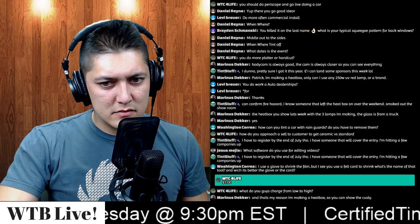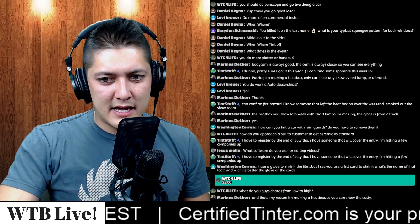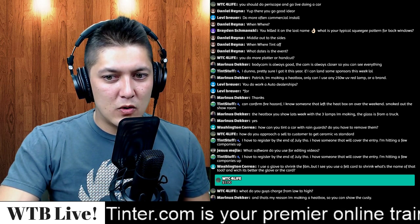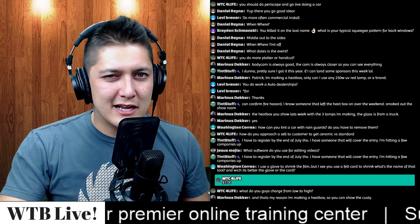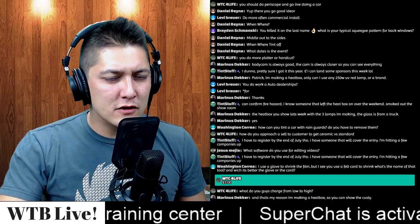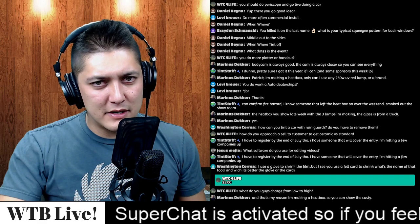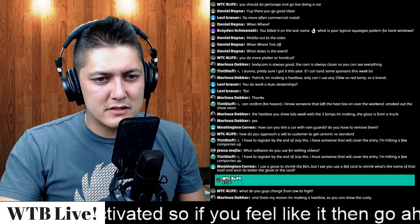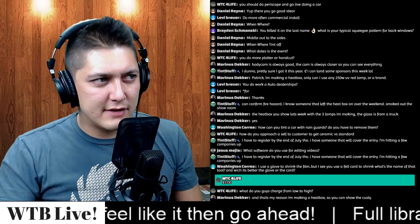Installing? When you're shrinking MacTac and when you're installing, I wouldn't use a Blue Max or a red line. I would probably use something softer, like the Orange Crush is a really good soft one. The Clear Max, but the Clear Max are expensive now. But the Clear Max and the Orange Crush are softer. The durometer is softer, therefore it's going to help wrap around certain things a little bit easier and really push down into those grooves with those dots and dot matrix. Softer tools will kind of help you. They'll be your friend. Good question, David.